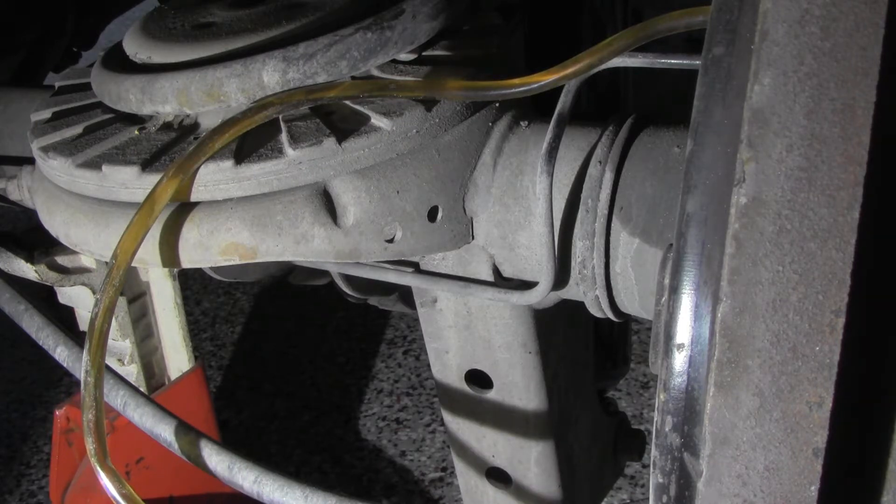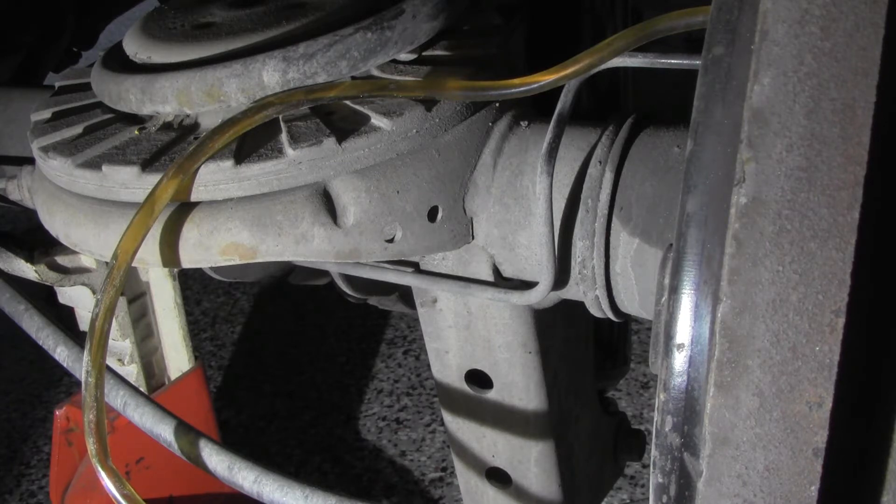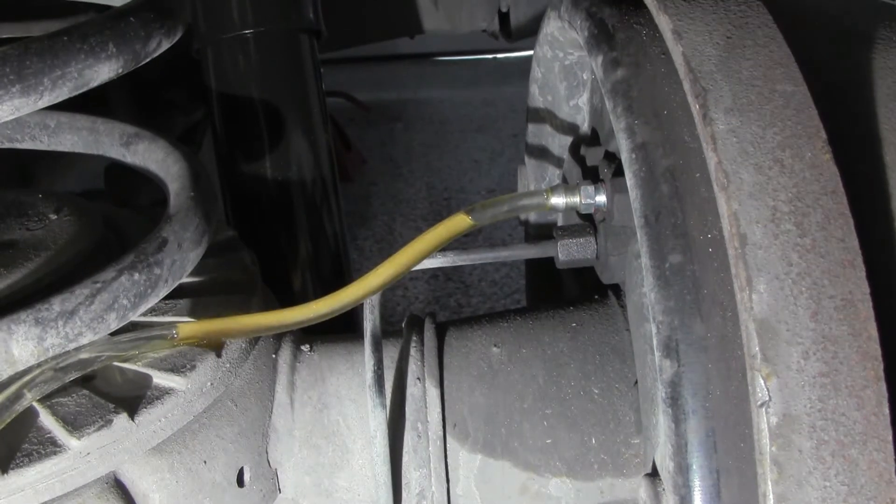As you can see the old fluid is coming out, and I'll start putting in the new fluid once we drain the reservoir down a bit. We started with the right rear wheel which has the longest brake line. So typically you would start from the right rear, left rear, right front, left front, because of the length of the brake lines. As you're pumping it, periodically check your reservoir to make sure that you don't bleed it dry. You want to get it low but not empty.